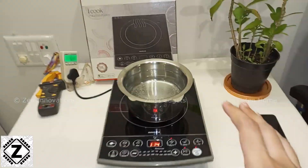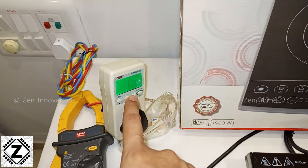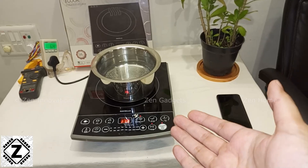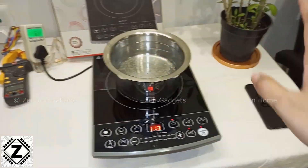So to summarize the amperes: the minimum we saw was about 3.5 amps, and the minimum wattage we saw was 1000 or 1100 watts. So make sure if you want to run this induction cooktop, you have a generator or an inverter which is rated at least 2000 watts. Otherwise it is not going to work.